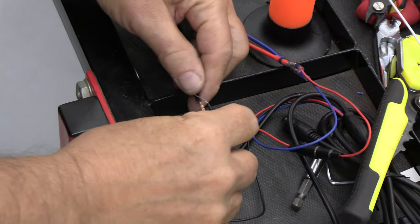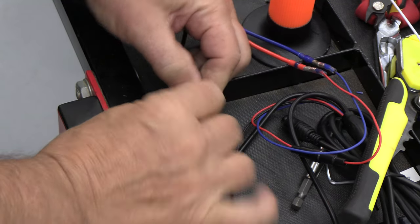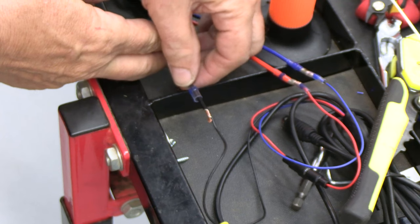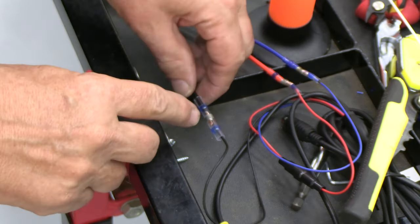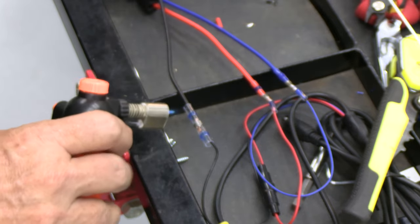Okay, so we've got our wires. I wrap this like that, bring the coil over that. That's got the shrink wrap and solder. Carefully not to dislodge it. Center the silver part over the area to be soldered. And we'll just heat it up.